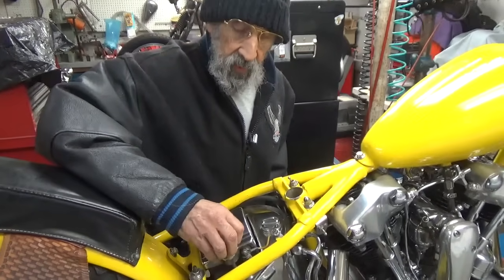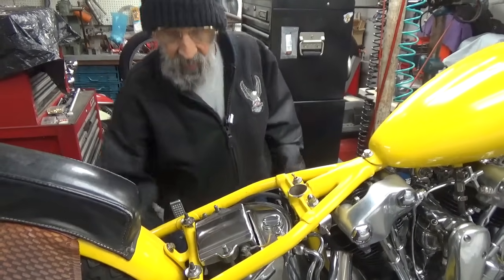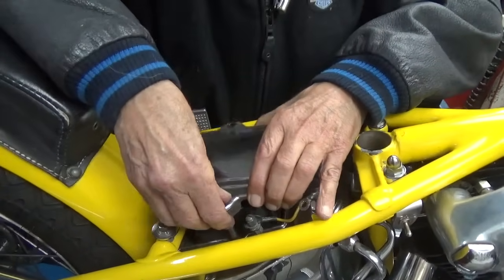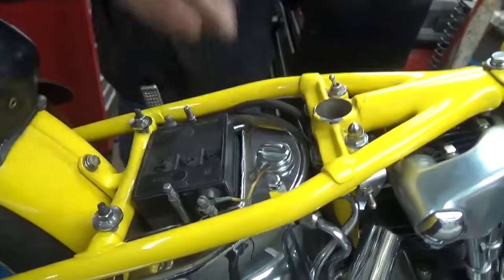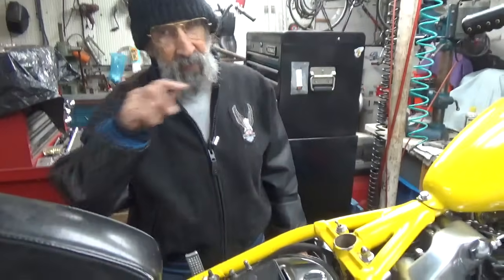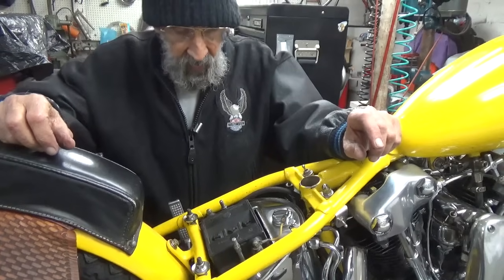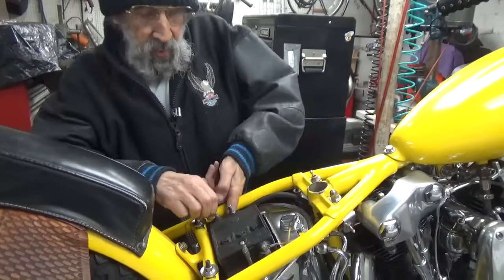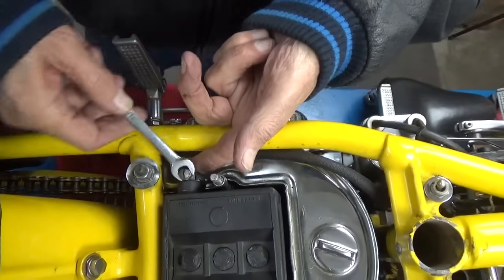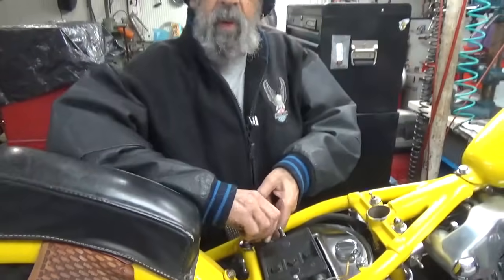I've had different kinds of batteries over the years, but it's always looked just like this on top as long as I've had it. Getting the cover off now — I've got the ground cable disconnected before I did any of this; don't need to make sparks and ruin anything. As you can see, I have what looks like a nice stock battery in there. I'm going to take the wires loose from the positive side.